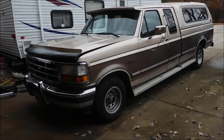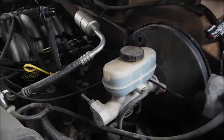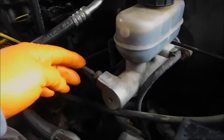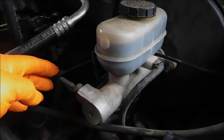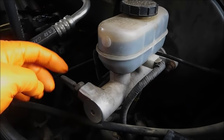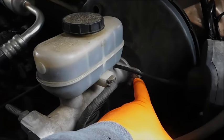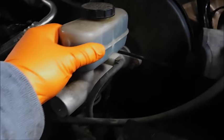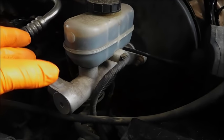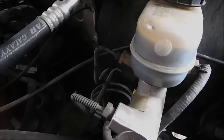My goal is to not disconnect the master cylinder from the brake lines — there's no reason to, since the master cylinder is working fine. I'm going to leave the lines connected, but I'll remove the two 14-millimeter nuts here and manipulate the master cylinder slightly away from the booster, getting it a little to the side and out of the way. I don't want to bend the lines very much, but they will move some.